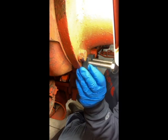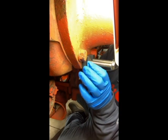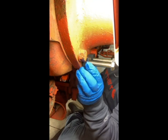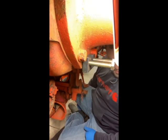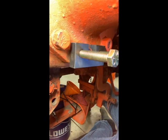We'll take our tool and slot it up around the pin. I'm just going to square it up here and tighten up those two grade-eight bolts. This is where the magic is supposed to happen — I'm skeptical. I'm just going to use my three-quarter-inch impact to tighten up. Man, that is amazing guys — that thing is already going out!